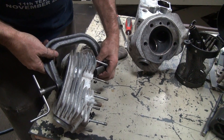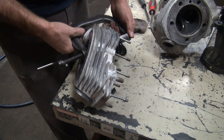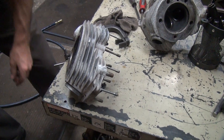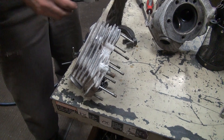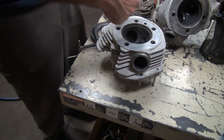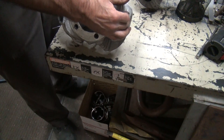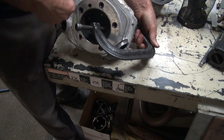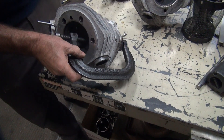We've got those other heads too that came with the whole project — maybe we'll use a different set of heads. They're high-flow stock Harley heads, actually 75 casts. The good ones — I can show them to you. If we're going to do anything I'd rather use those; these ones are worn out too. You take this, clean them up, blasted, put a bunch of red goop around here, do a quick lap, put it back together — it's rebuilt, it's on eBay for 600 bucks. Not that they would ever do that... it's almost a given. Some people have no scruples or morals.